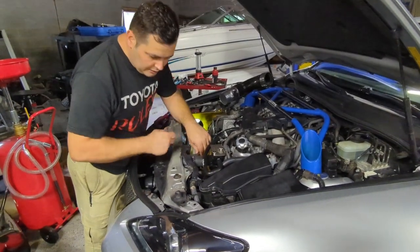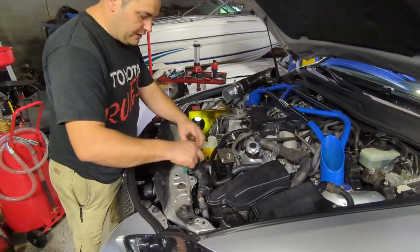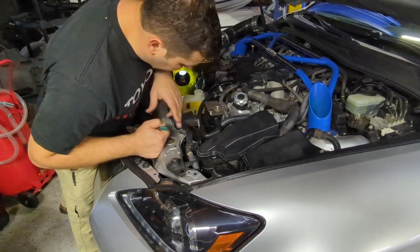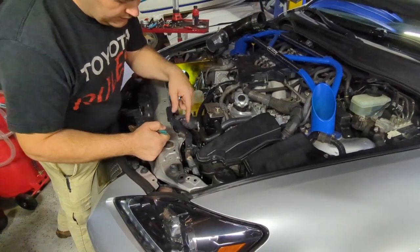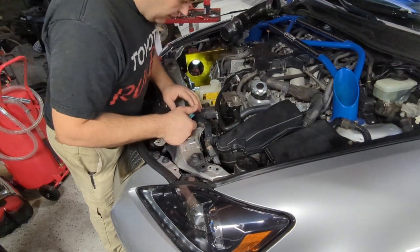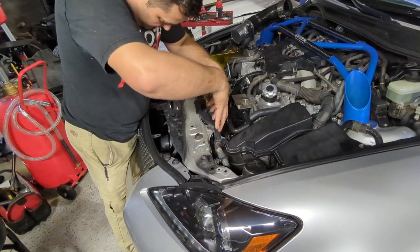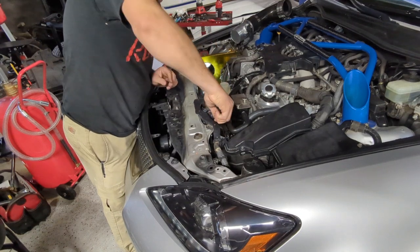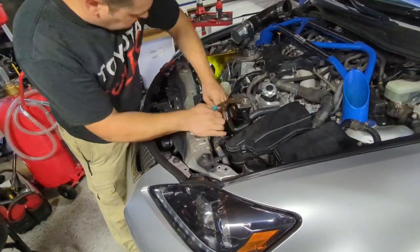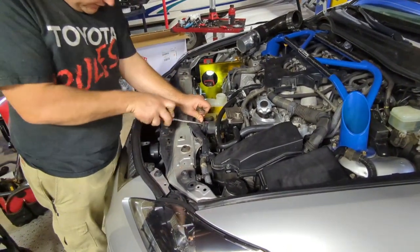So now we're back on top of the car. So this has to be completely come off, okay? And obviously your top hose and everything has to start sliding out that way, and then disconnect everything. There's also a breather hose here attached to the radiator fan shroud that actually some of the fans blow air into the ECU, which is something you have to disconnect right over here, and all the connections. So let me get started on that, and then we'll go from there. And this radiator is going to be replaced, and also all these hoses.